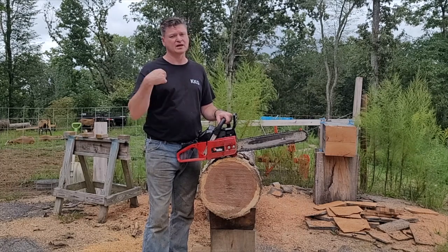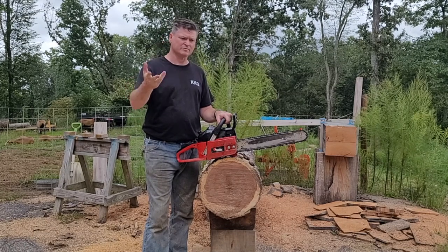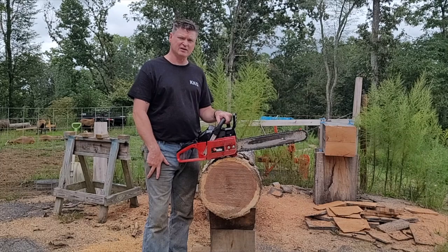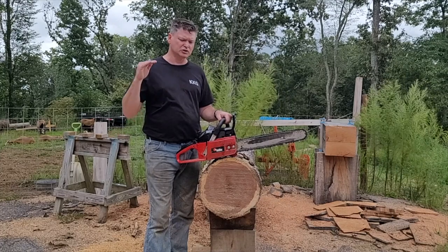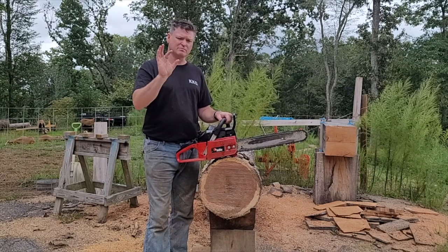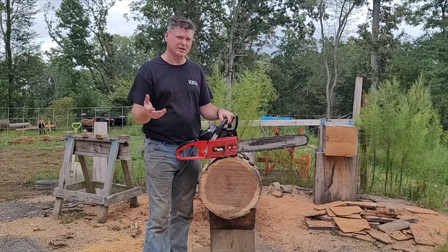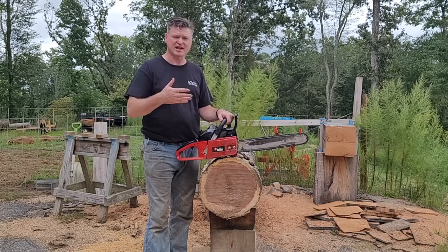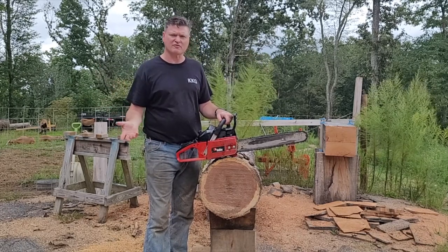But I do feel like it is a lot easier on the saw. Those teeth, that cutting, it just seems like it's more like a 325 chain or a 3/8 low profile chain, you know? I also feel like maybe I should take the rakers down further. But I've already got that thing. My little depth gauge is worn out really bad. So on the setting for hardwood, it's the same depth as the setting for pine. So I got it set up for softwood, really.